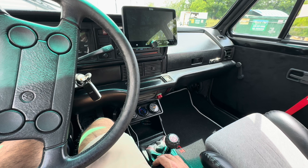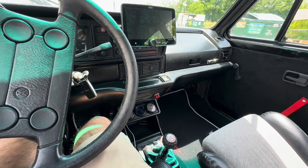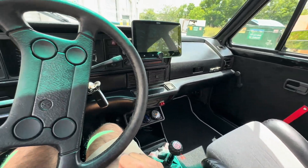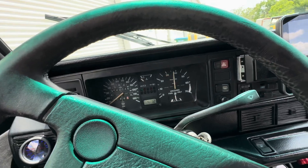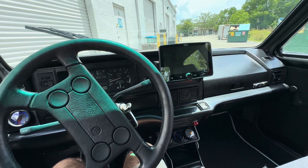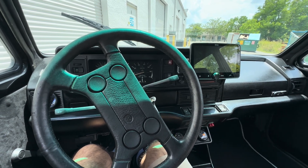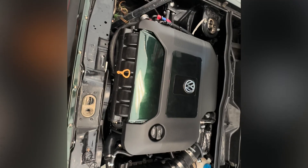That's it, guys. I know it's been a lot with this whole fuel situation, but I fixed that part. I did go get gas and it was still kind of clicking, so I need to check the line from the top of the tank going to the vent — make sure I got no kinks in that. I don't think so, but I'll check it. I don't smell anything though. Don't forget to subscribe, give me a thumbs up, comment below. Walbro is the way to go. Thanks again for watching, see you guys on the next one.